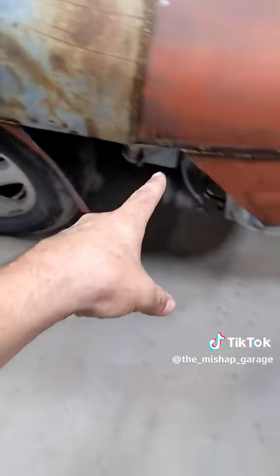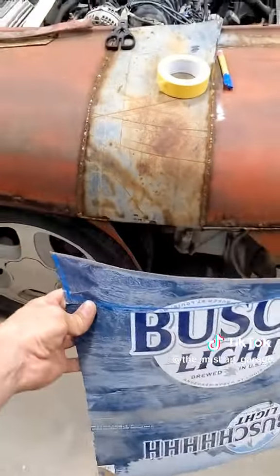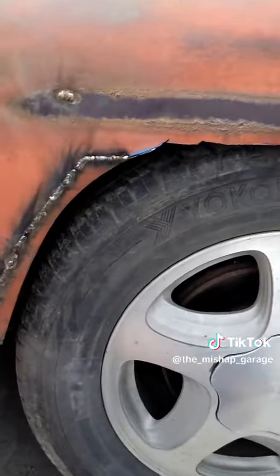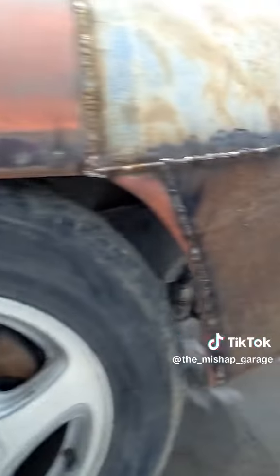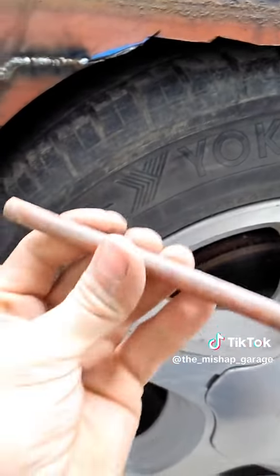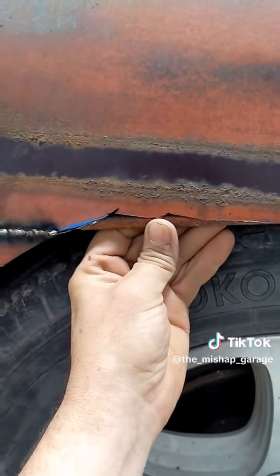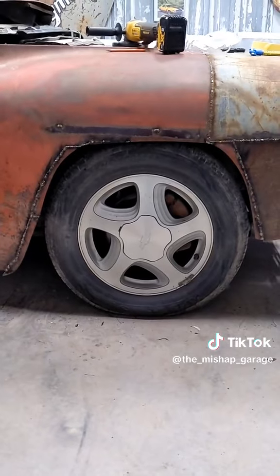Nothing is actually welded to the car except for the actual body structure of the unibody. Let's go ahead and fill in this right here. What you need is some cardboard — make your template. I believe this is a 1940 Chevy hood piece that popped right on here and we'll cut that out. Now that I got that welded solid — that was actually broken right there so I had to splice it. Because I extended this back, I have this weird cut I made here, so I found a piece of rebar that matches and I'll weld that in right there and you won't be able to tell it's not factory.